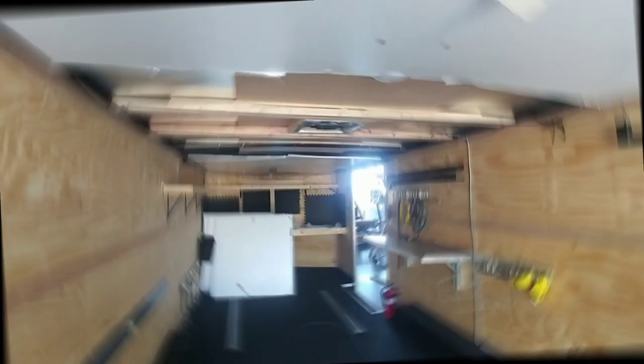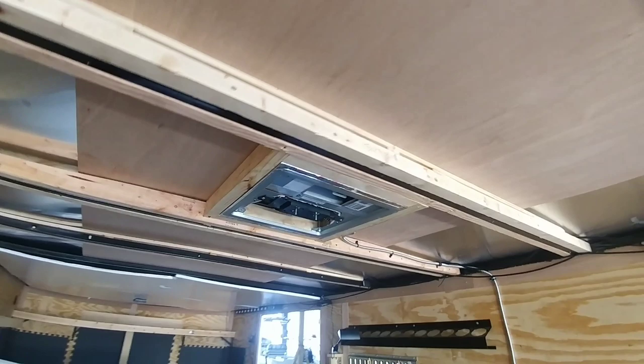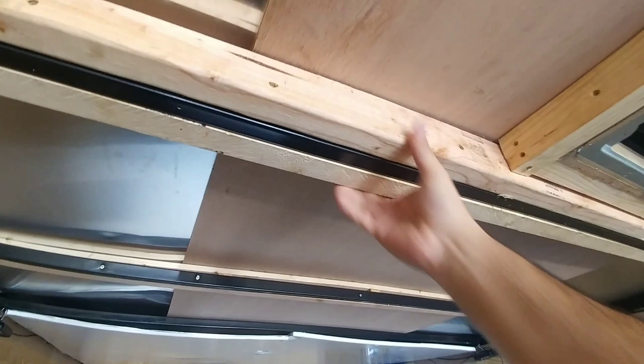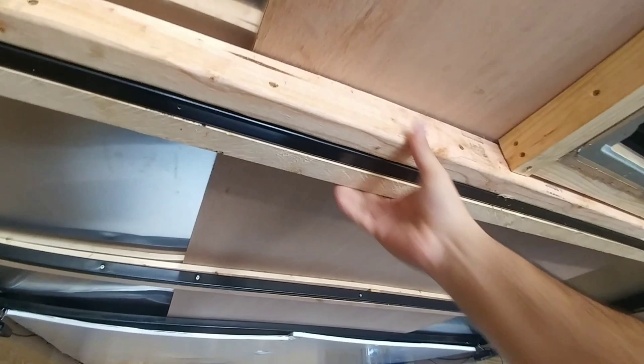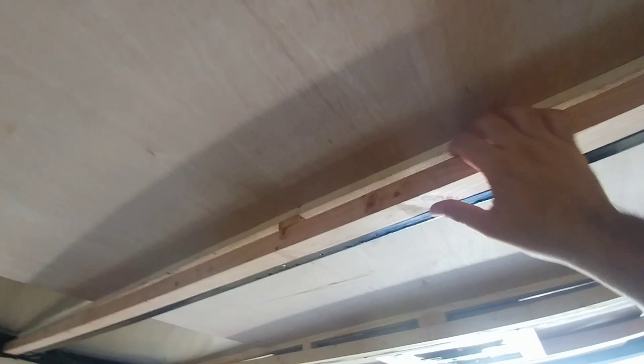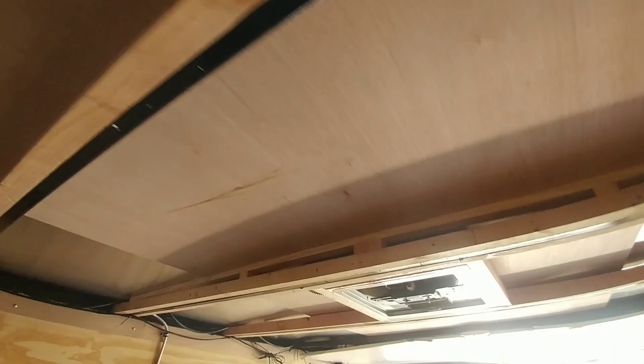We are here on the final day of installing the air conditioning unit in this CargoMate trailer. You can see just the type of work they do here — they made some really nice ceiling joists to support it, going all the way back to create a nice arch across it because you want it to be able to drain any condensation that builds up. They used two-by lumber on both sides of the factory steel support, framed the whole unit in construction lumber, and even added an additional piece of lumber to support it in the back and create that radius arch so water drains off well. This is very sturdy now — this is really probably how they should have designed the interior of this trailer in the first place.